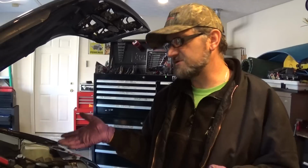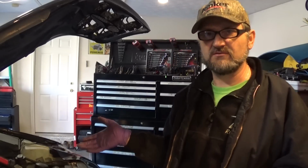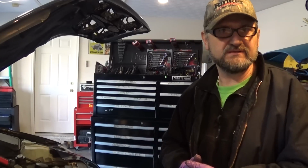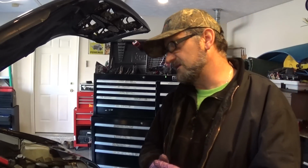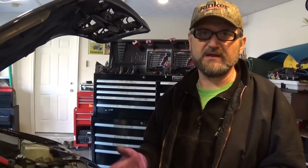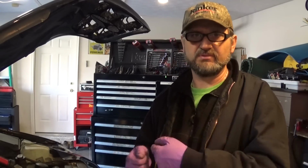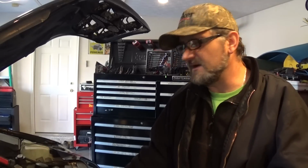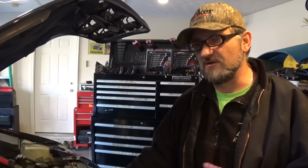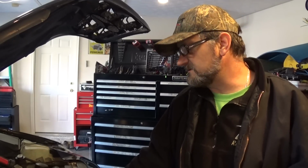Of course, check for battery voltage at your connector, and I think that's all you've got to do. I think the most common problem is actually the plugged up pipe anyway. To clean it up, just get some wires, get some brushes, and brush it through there. It's not rocket science. You just get it cleaned up. What I also did with the pipe was put it on my faucet with hot water running through it, to get as much of the carbon out as you can, and that's it.